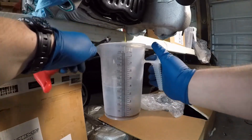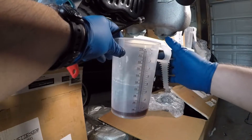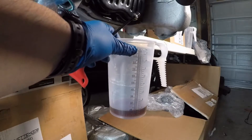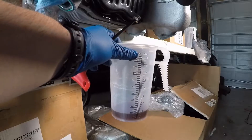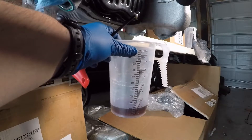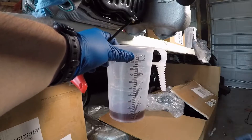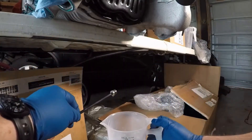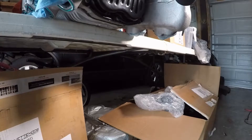It looks like that guy was definitely ready to be changed. This supercharger has got 40,000 miles on it. The smell doesn't smell too terribly bad. Hopefully this is the original oil from the factory. The person on eBay mentioned they changed the oil on it quite often, but I'm not sure if they were confusing that with the engine oil, because I highly doubt they would have pulled the supercharger off every year to change it — but you never know. Let that drip and I'm going to get a rag and clean off this plug.